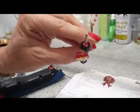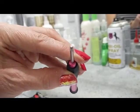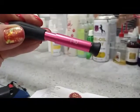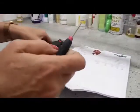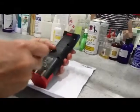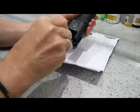You're going to need a Torx screwdriver — I don't know if you can see the end of that, it's a star shape — and this is the number 10 size. You need to take out six screws to take the body off. The first thing you need to do is take the battery off, of course. There's a seventh little screw in there that catches lots of people out; this one's only a half-size screw.